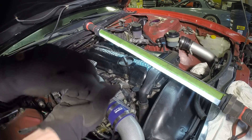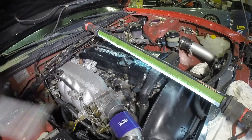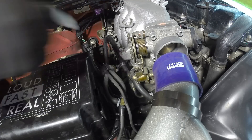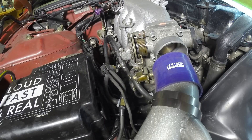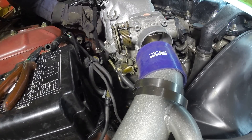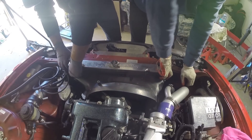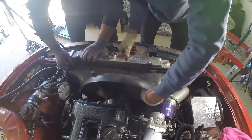The intercooler pipe needs to be removed off the throttle body, and so does the cable. There are actually a few vacuum lines that you'll also need to remove from the throttle body, and then you can tackle the fuel lines. I usually mark one line so I won't reverse them when putting them back on. The ignition coils are next, and I pulled the radiator out at this point — it really can be done anytime you please, but it's definitely nice to have out of the way when it comes to pulling the head.